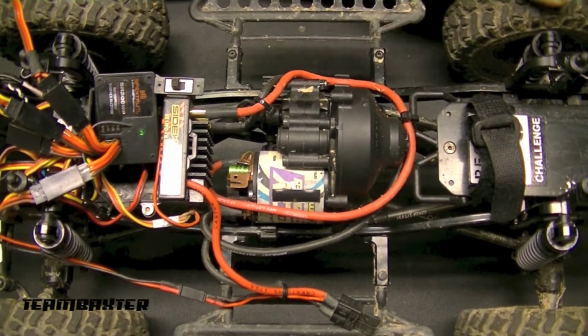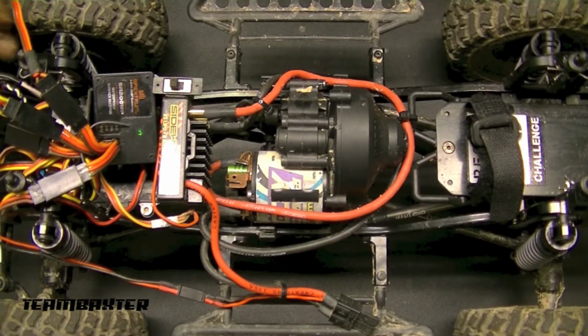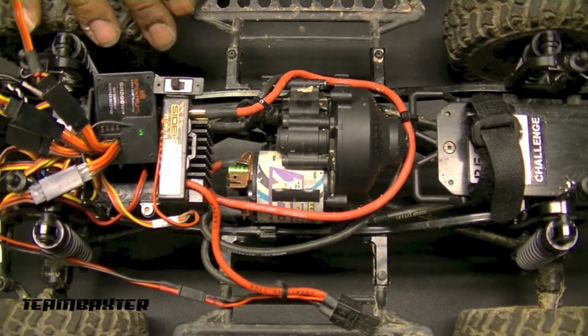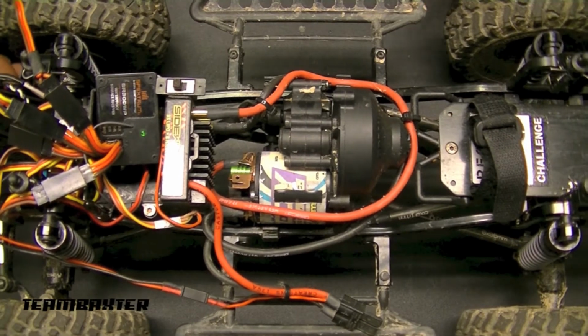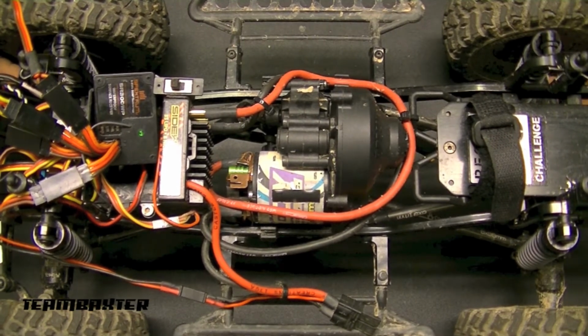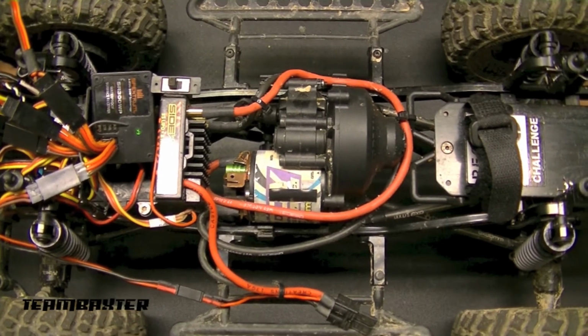I've clocked the axle extreme in the back and not so much in the front, so what I'm going to do is match the rear axle to the front axle. The links are the same, so the axle should perform the same at the same position. So I'll get the rear axle fixed.